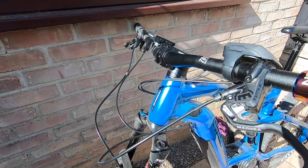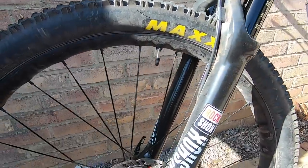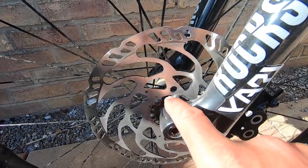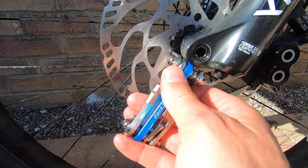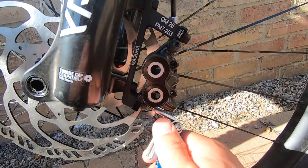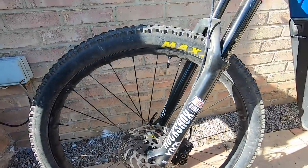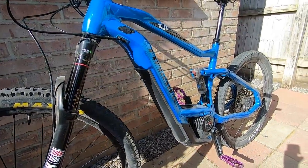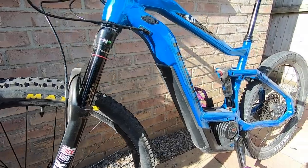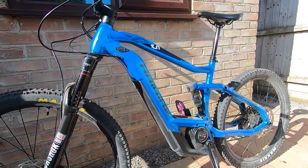Once happy with the front end of the bike, move down to the forks for a quick inspection of the seals and check for any marks on the stanchions. Moving down to the front wheel axle, make sure that's nice and tight, and check those rotor bolts — if they're loose, tighten them with the multi-tool or add some Loctite. Check the front brake isn't rubbing; if it is, undo the two caliper bolts and re-centralize it. Then do a bolt check the whole way over the bike — anything you can put an Allen key into, make sure it's tight. Inspect the tires for damage, spin the wheels to make sure they're running true, and finish with a degrease and lube of your drivetrain.